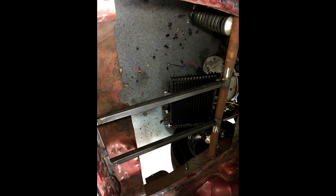Everybody's like, when are you going to race this thing? Well, we thought we'd be racing it sooner than this, but the fact of the matter is it has no rear firewall. The fuel tank, which is large, is supported by rubber bungee cords, and the battery isn't held down at all. So if we had to hit the brakes, we'd be eating a battery and spilling a 15-gallon fuel tank all over ourselves.